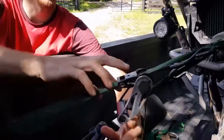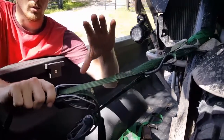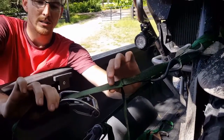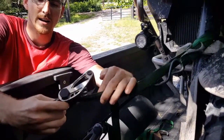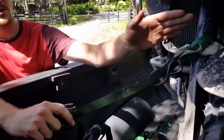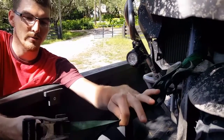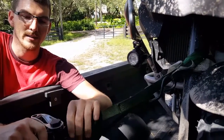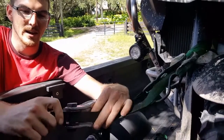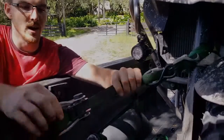I'm going to release one of these to show you. Normally when you tie down a suspension bike that's normal, you don't use as much pre-slack on the tie-down. But because when you tie this down the suspension does not compress, I set myself up with a good amount of pre-slack to get it wrapped around that cam inside there, so that when you're ratcheting it, you have it kind of loose initially set up.